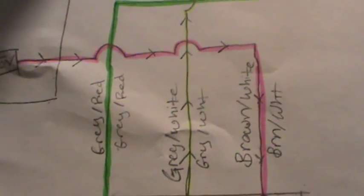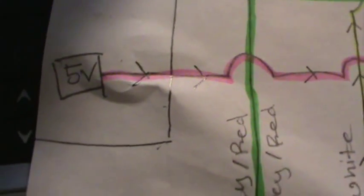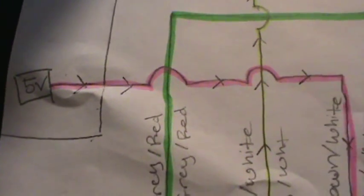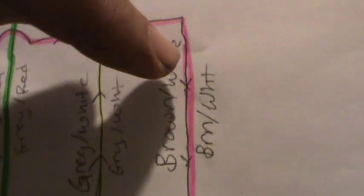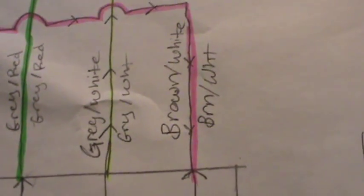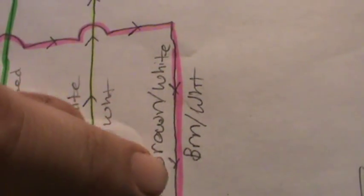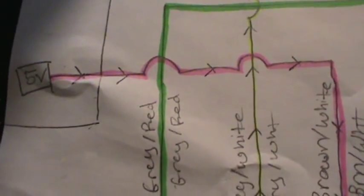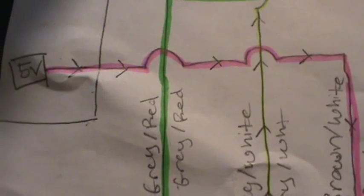And then over here you've got the five volts, but it's just the five volts — there is no resistor. Five volts being sent out. Now on this system right here, anywhere you see on this pink — which is actually a brown and white — by the way, this is a wiring diagram off of a Ford Ranger. If you have a short to ground — in other words, if this wire rubs through and it touches an exhaust manifold or touches something sharp, anything metal, it rubs through and it touches metal anywhere here — it's going to want to shut down the computer and your computer is not going to function properly.